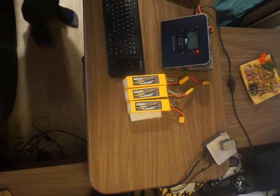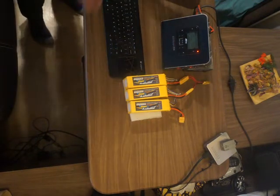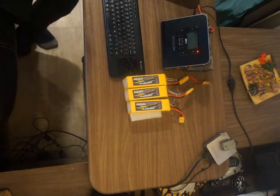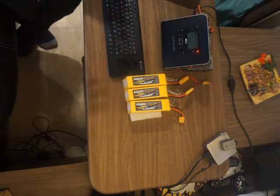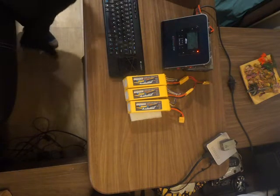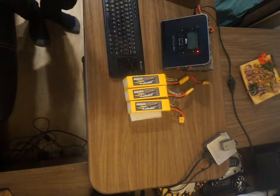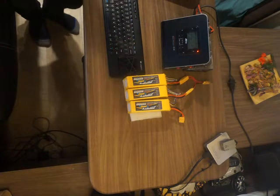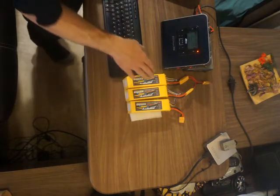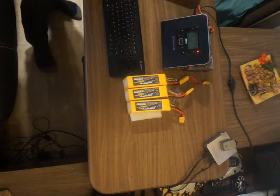Specifically, in this case I'm using a 4.5-kilowatt system. Depending on the pack I use, I've got a 60-amp controller and I'm looking for 40-amps continuous. I'm riding mixed trail, from cross-country to what you might call downhill enduro-style riding — hitting big jumps, doing distances, all sorts of different things with those bikes. So I'm looking for really high-performance output and top power delivery, and it seemed really obvious to me that the lithium polymer solution with a higher C-rating was going to deliver more punch in those situations.